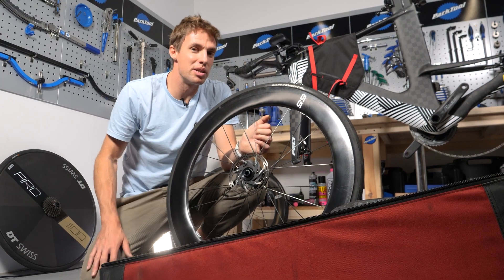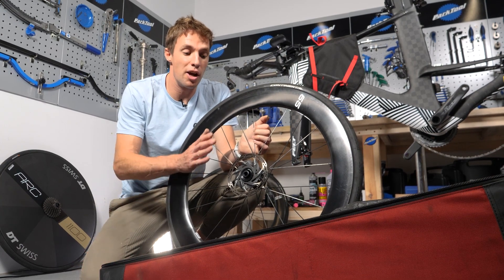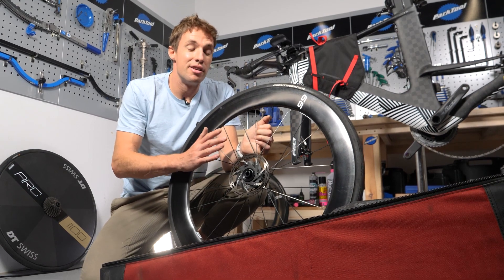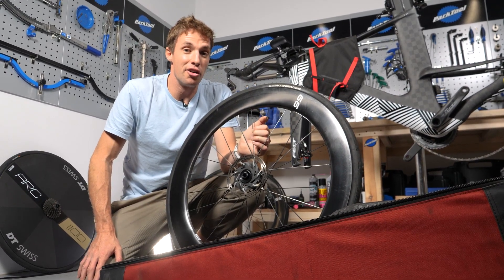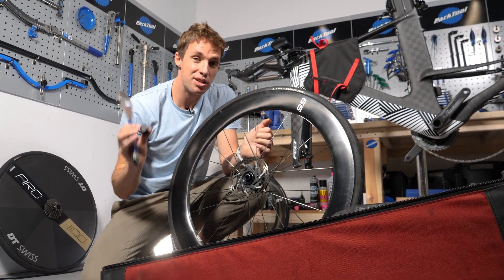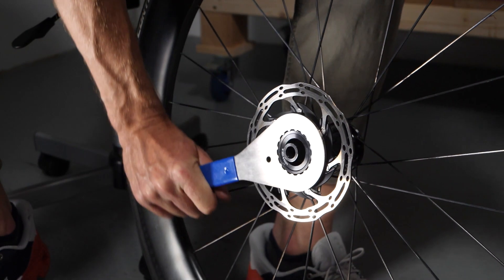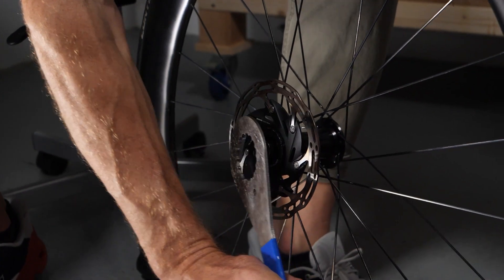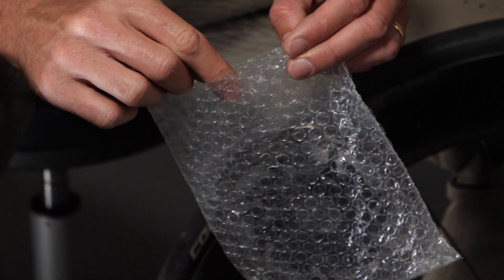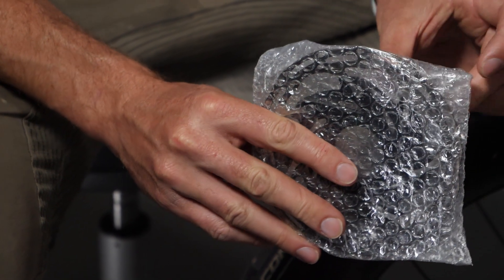You might think you've got somewhere safe to put your wheels and nothing will touch them, but after a few hours on the road something's going to shift and will be leaning on your precious brake rotors. It is very hard to protect brake rotors on a wheel that is not on the bike. You'll need either a bottom bracket tool or a cassette tool depending on the type you have — this one's a bottom bracket tool. You will buckle your rotors if you try to travel with them on your wheels. It's an easy job to remove them, then pack them somewhere safe in a zip-lock bag to avoid any grease or gunk on them, and in a firm box or next to something flat, and you're good to go.